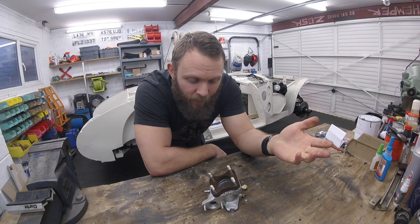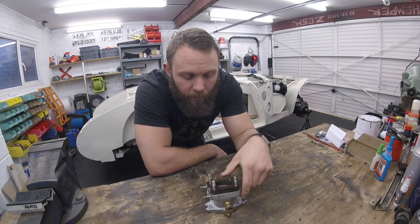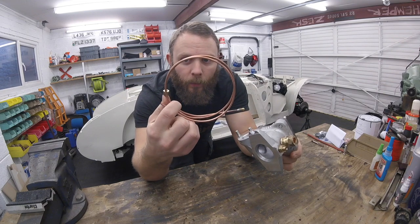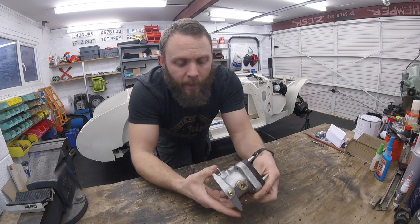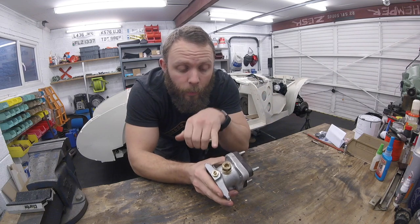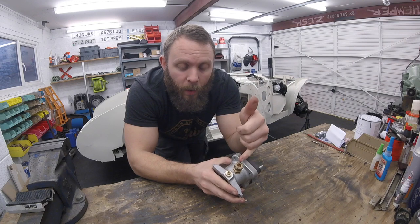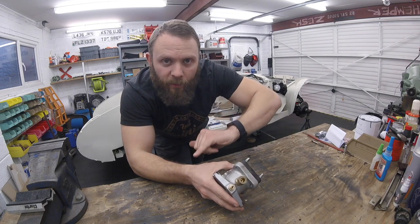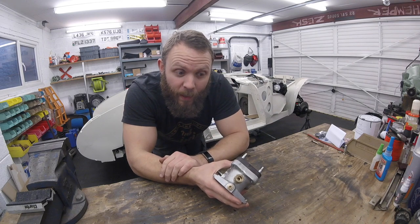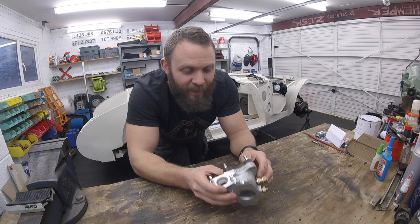Update time. We've got some longer studs — eventually they've been wound into the inlet manifold so we can now fit them to the car. Another thing to think about is our little spill tubes. We've got these little brass adapters into our inlet manifolds and then little copper spill tubes that run down the back of the block. We need to run a vacuum source off for our servo, so we've had the inlet manifold tapped to accept a quarter BSP to 10mm compression fitting, and then we're going to run a hard line 10mm copper, bend it round, pass it up the manifold and into the vacuum line for our servo from our previous video. So now it's time to fit them to the car — balance tube and then the carbs, the exciting part.